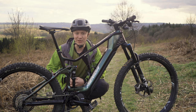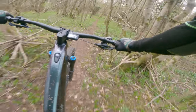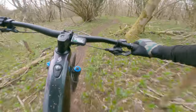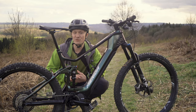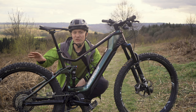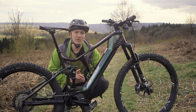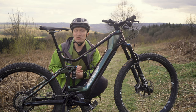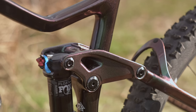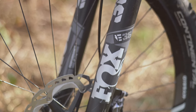This is where the trail e-bike comes in. This E140 has less suspension travel, but because it's designed for use on trails that are less wild than the E160, it's fitted with faster rolling tyres with less aggressive tread and lighter casings. These Continental Trail Kings are still grippy and tough, but they roll much faster than the tyres on the E160, so the amount of riding you'll get from a single charge is higher. The suspension is also different, with an inline rear shock and a fork with smaller diameter upper legs — 36mm on this bike — to help reduce weight.